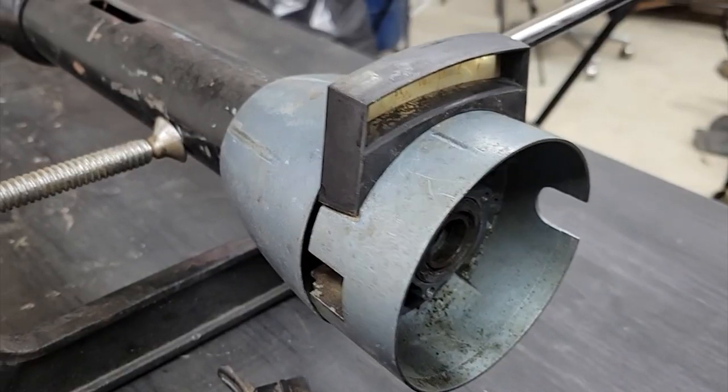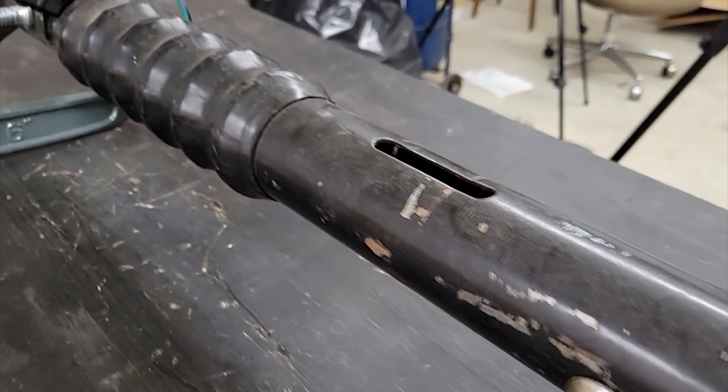On our 69 Fairlane we had to move it around just a little to get the neutral safety switch in the position where it would start in both neutral and in park. Most of the time it's going to need a little bit of motion to find the correct position. That's how easy this is on a tabletop. It's not that easy in the car — when you're on your back underneath the dash looking up, trying to put little bitty screws into the side of a round column while keeping the neutral safety switch where it's supposed to be, you're going to have some choice words.